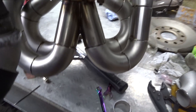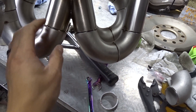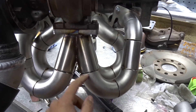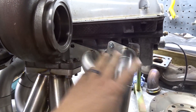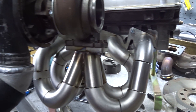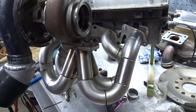I am really, really happy with how that's looking. A couple of things to mention: the fit-up doesn't look great, but there's a reason for that — I've left them slightly longer because when this gets fully welded they do tend to shrink, so that should bring everything into place quite nicely. You might have also noticed the ports are not round like the pipes. Once I've welded it all up I will squish the ends and flatten them off, and hopefully they'll all line up nicely.